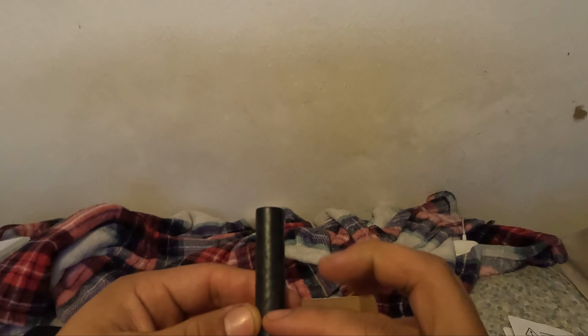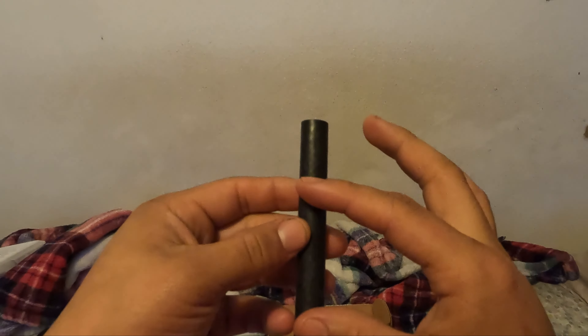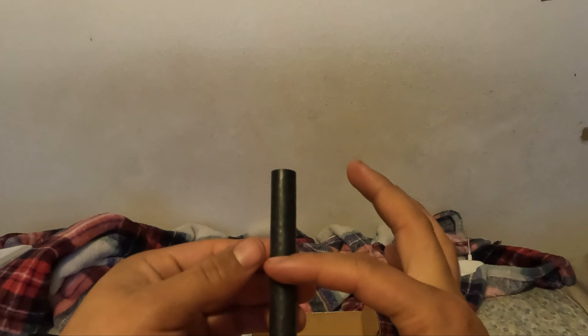Here are your hose clamps that you'll need. Some fuel pumps come with S-hoses but this one doesn't — it just has a straight hose, so it's going to line up perfectly with where the fitting needs to be. You'll probably have to cut it in half, but each car is different, so route it however you want.